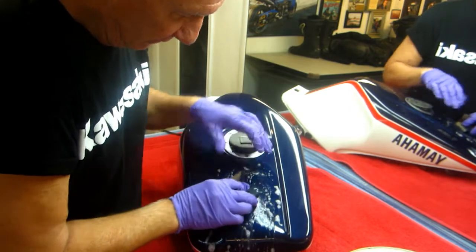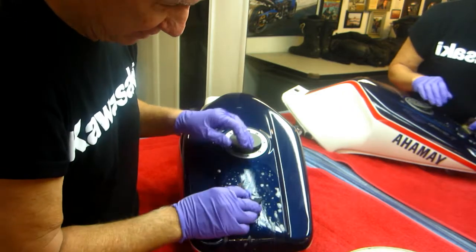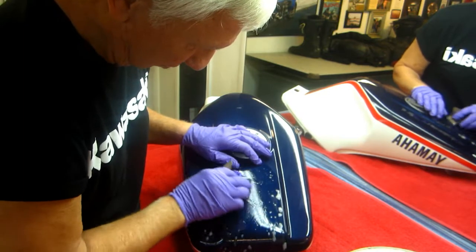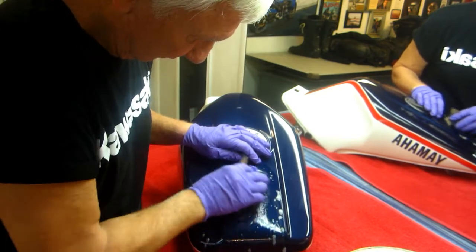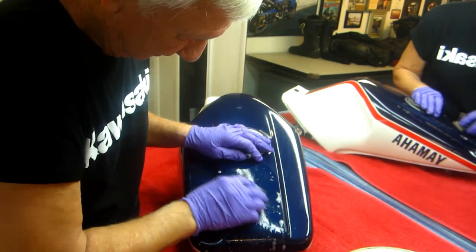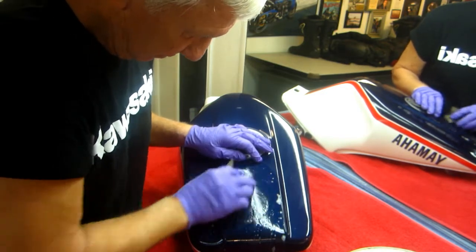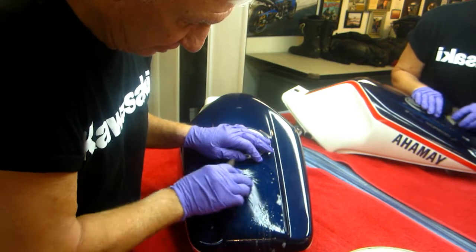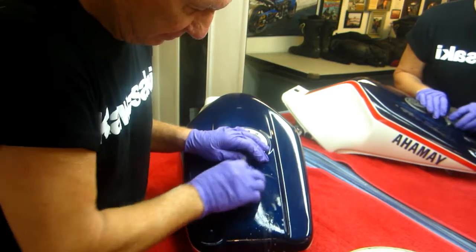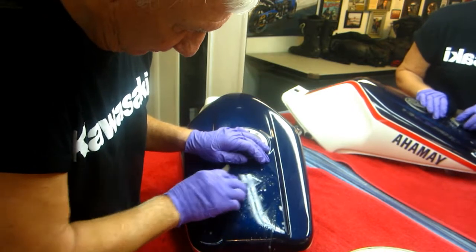Now, you never know. If this is on a curved surface, you really have to be ultra delicate. In the case of this, it's on a flat. I'll just keep track of the time here, give Mark some idea how much, since we charge him by the hour, by the bagel or whatever. I really hope he didn't go down into the blue here, but you never know. 1000 grit is going to take a little time. If you use 600 or rougher grit, it'll go quicker, but then you leave what I call sanding scratches, that hopefully we're not going to have in a final part, even if we re-clear it.